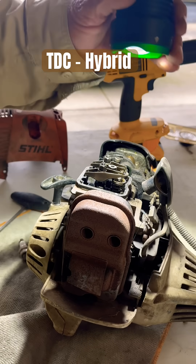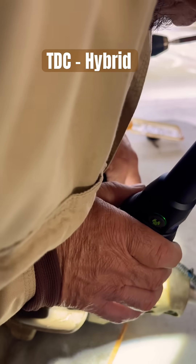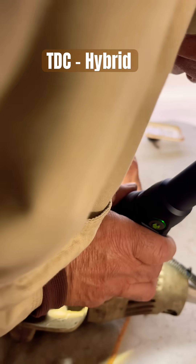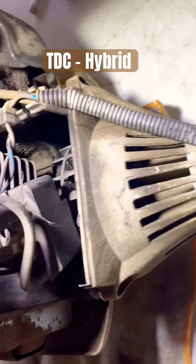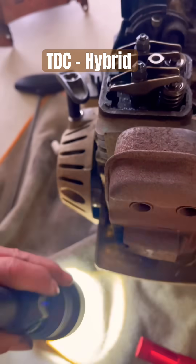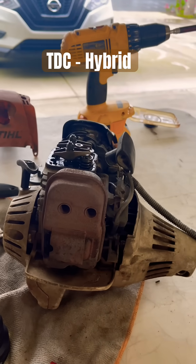At this point we're going to look at the arrow, which has got to be pointing at the bolt — that's where your magnet is. There's your arrow and it's pointing at that bottom screw, so we've determined that we're at top dead center at the proper timing.